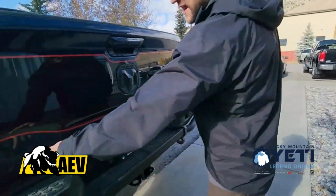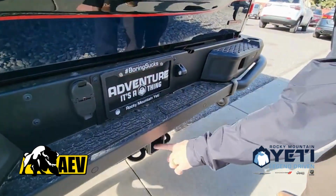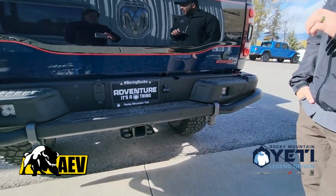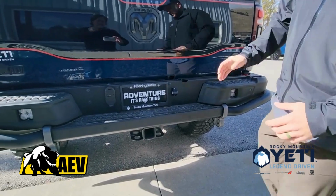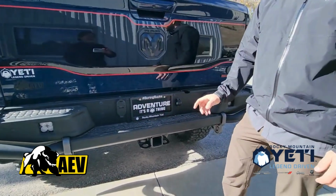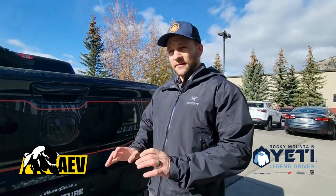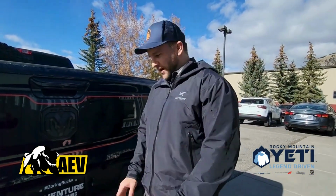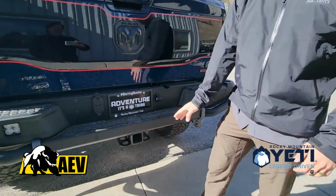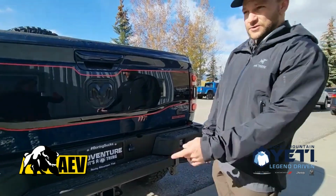All right, little things, the AEV branding and badging. Step plate. Another big one is the factory hitch receiver. The reason I say that it's a big deal is you look at a lot of aftermarket bumpers, and what they do is they throw this away, and then they cut a piece out of their bumper for your tow hitch. The problem with that is your warranty for your towing is only valid if you're keeping the factory hitch receiver. You put somebody else's hitch receiver, I don't care if your bike falls off, that's on you. So you're only going to maintain your warranty for towing if you have the factory hitch receiver. Kind of a big deal. We do the same thing with the Wranglers.